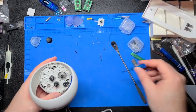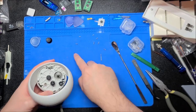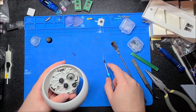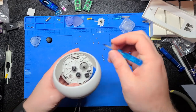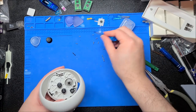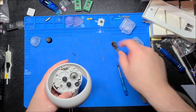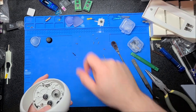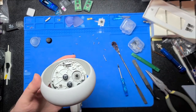Okay, that was a bit of a pain. To note: the screw that goes here is the black one, as it's magnetized. The one down here is the other long one. All the other screws are the same length, with the exception of the ones tilted at the top — those two are the shorter screws. So pretty much it's just these four screws at the very bottom and very top that you need to keep track of.